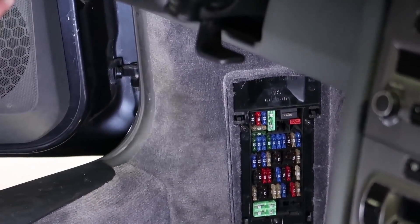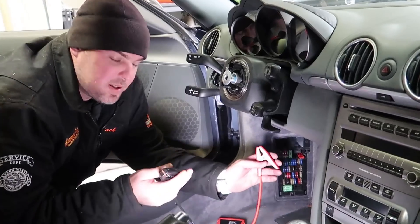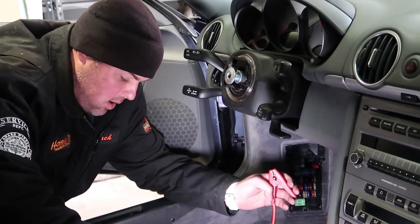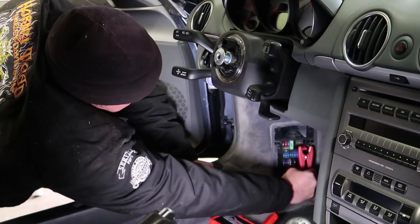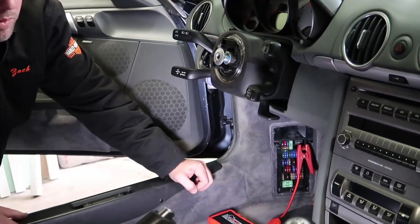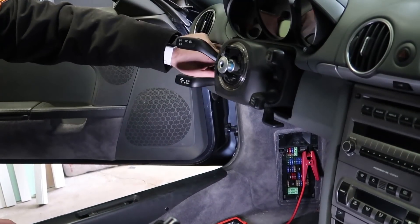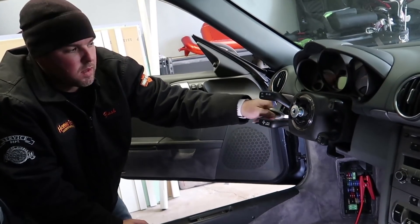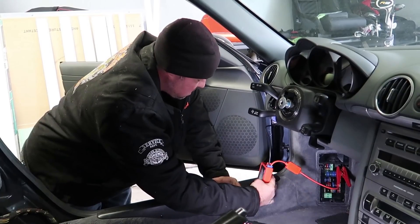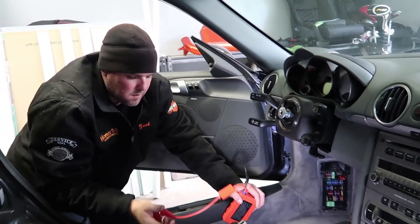This little red square here shows a picture of the car with the hood — pull that out. There are contacts on both sides. I'm gonna take the negative and put it to a ground on this seat bolt right here, and take the positive and put it on the lead. We got power — let's see if we got enough. And we don't. The jumper pack is dead — as they say, a jumper pack isn't any good if it doesn't have any power.